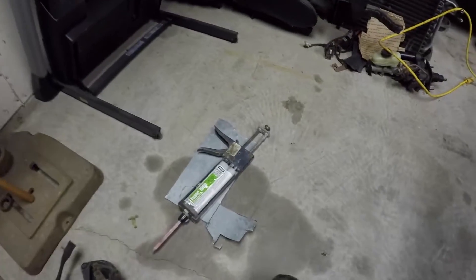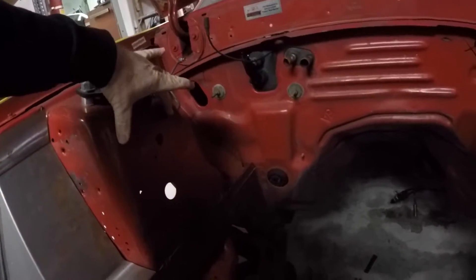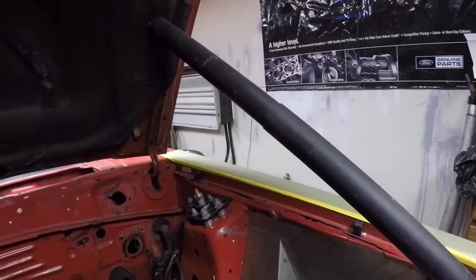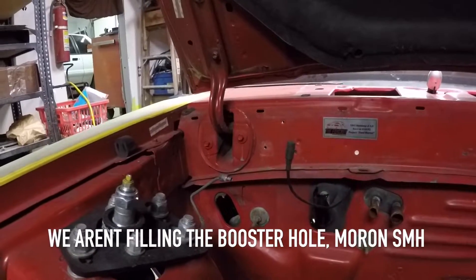You've got some larger ones on that side too. The larger holes you can't just weld in, so you've got to cover them or come in from behind and tack something in. What we're going to do with these larger holes is use sheet metal and metal bonding adhesive - basically cut and make little mock-up panels. Everything is going to be flushed in anyway, so we'll just cover holes like this, make a cutout that covers it, same thing on this shock tower. Then use filler, sand it, fill it, sand it - you get the idea.